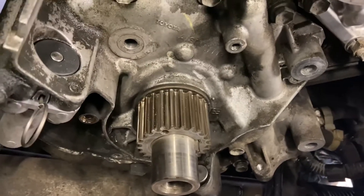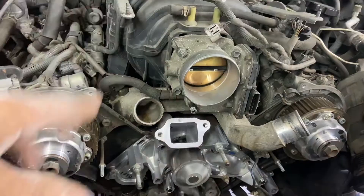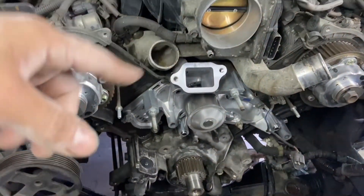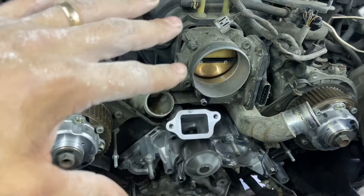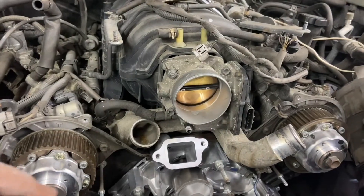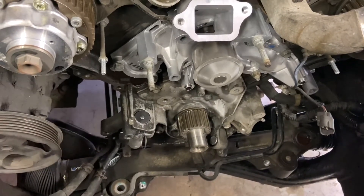This whole face that looks like it unbolts — it does — that is in fact the oil pump on this engine. Here's where we're at: I subscribed to Toyota TechStream. Step one, de-charge the fuel system — pull the fuse for the pump and run the car until it dies. Step two, disconnect the battery. Step three, remove the engine, and in that set of instructions step 36 is remove the transmission. So this is an awful, awful job. Even with a lift, even with Toyota training, this is a miserable job. I'm trying to do it without removing the motor, and I'm very confident I'm going to be successful.